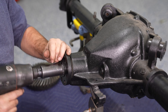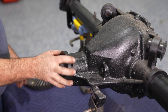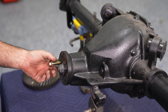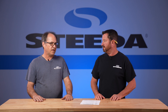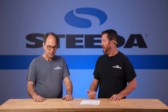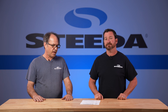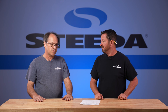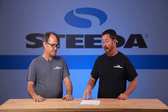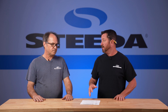If you're a first timer just driving on the impact, you can get it too tight. If you over-collapse that sleeve and try to run it that way, you're just going to burn the pinion bearings up. You would then need to remove the front pinion nut, take the pinion back out, put a new sleeve in, and start over. That's going to save you a lot of time in the long run — the last thing you want to do is chew up your rear end because you had it too tight.